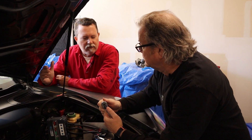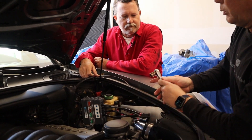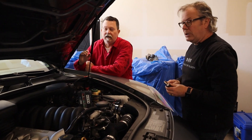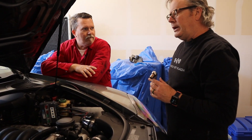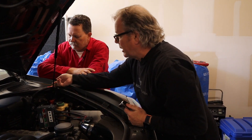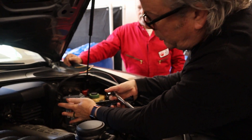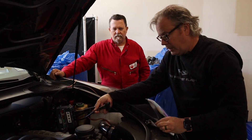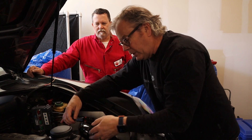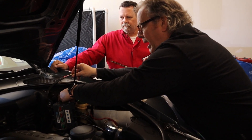So for about $300 total, you've got a great setup here under your beauty cover, ready to go. You've got four different fuses and wires you can access — lights here, lights other places, lights on the roof — all run through this device. When we did lights in our other Cayenne, they ran all the way through underneath the car. This seems like a much better solution. We do have to punch one small hole in the fuse box to attach the trigger wire, but no drilling through the firewall. Each output corresponds to a fuse — I've got two 30-amp and two 10-amp — and we're going to use one of the 30-amp fuses for the lights.